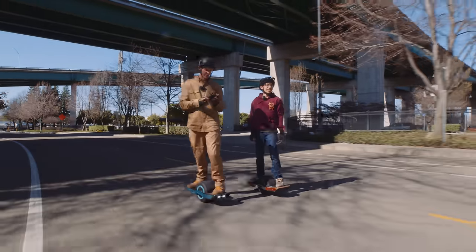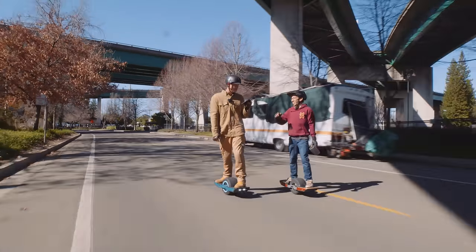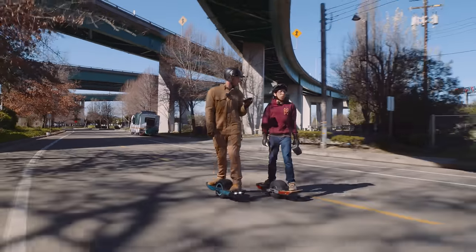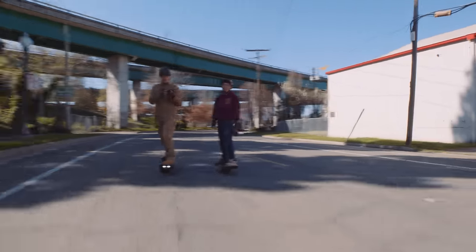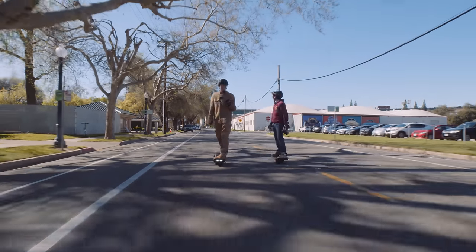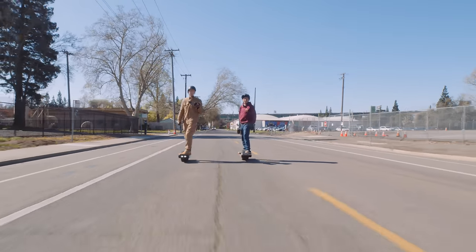It's 100% mental at that point — I felt like it had a lot more to give. My max duty cycle I hit there was 50% at 32 miles an hour. I was hammering the nose. At those speeds duty cycle kind of spikes a lot, but field weakening will slowly kick in. As you approach higher speeds, it'll probably plateau around there. This thing is scary powerful. The tune isn't perfect, but that's easy to change — that's the beauty of VESC.